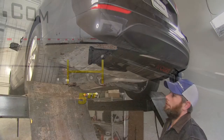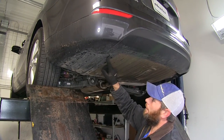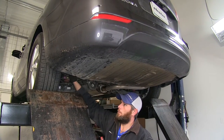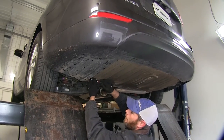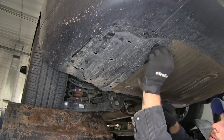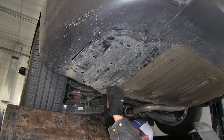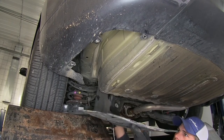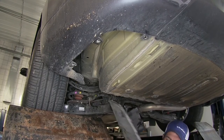To get the car ready for our hitch, we want to expose our weld nuts that are right underneath this panel. So we're going to take off the six push pin fasteners that hold it into place. We'll just use a screwdriver to pop the middle of them out, and then they should just pull right out. We'll return the panel to the customer or set it aside in your garage — if you ever take your hitch off, you can put it back on.